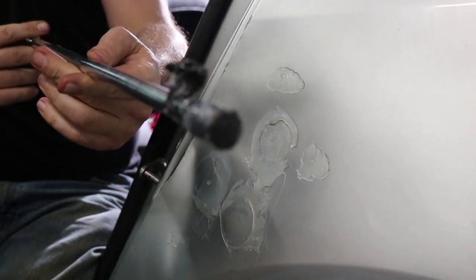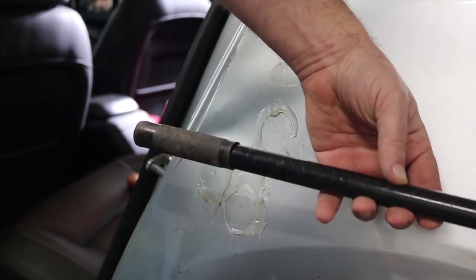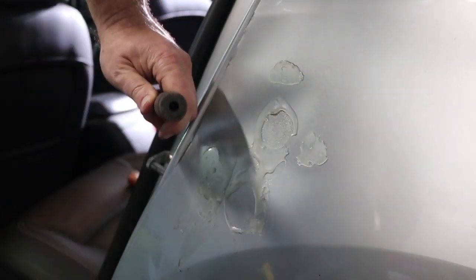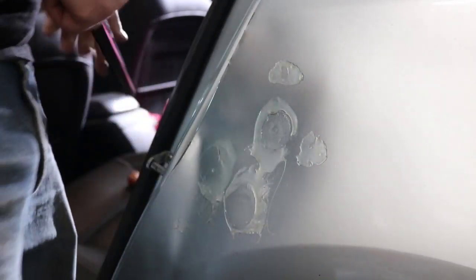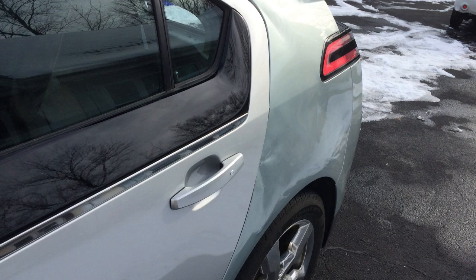I need something similar but a little shorter so I can see outside and hammer from the inside at the same time. This here is the handle of my hydraulic floor jack — it's a thick but small diameter steel pipe and the end has a rubber handle, so I can just stick this through. Rubber shouldn't scratch things up too badly, and it's shorter so I can pound from the inside while still looking at this. It was still pretty tough to get nice and close to the door frame, but I did manage to bend some of the metal out. I did also break the paint right there, which wasn't so terrible because right next to it was a break in the paint anyways. But essentially I did make the entire dent less.